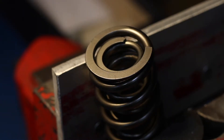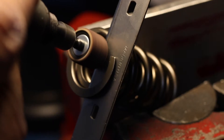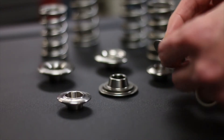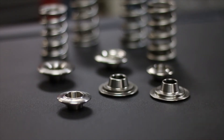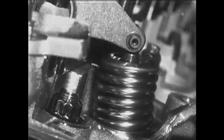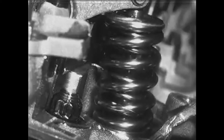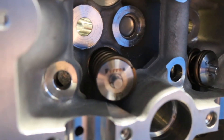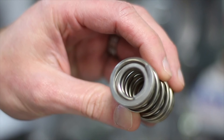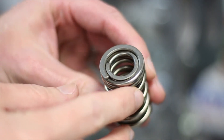What we do is grab the metal underneath the wire and use a dremel to round off the edge around the top and bottom of the spring where it's been cut off. This improves the amount of wear on the bottom side of the retainer enormously, because the retainer is going to move — and that's really prominent in any valve train. You're going to have some valve float, whether continuous or intermittent. The spring needs movement, the retainer needs movement, and so does the valve area. Dressing the spring and rounding those edges will improve the wear characteristics on the bottom of the retainer significantly.